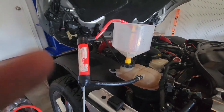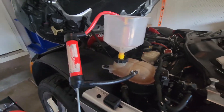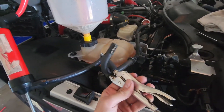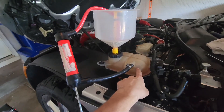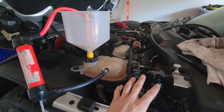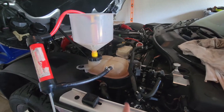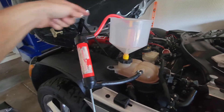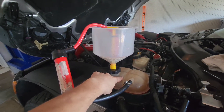Here's the setup — I'm gonna attempt to show you how I pulled the air out of the whole system. You clamp this off using my special clamping method. You're gonna pump air out of the reservoir. I've got check valves, one-way valves in there, so the return hoses are all full of coolant — I already did that beforehand, that's really easy, it's just a reverse of this. Pumping air out of the reservoir is gonna suck all the bubbles from the whole system and dump them into the top here.